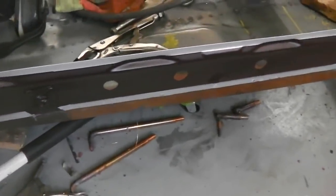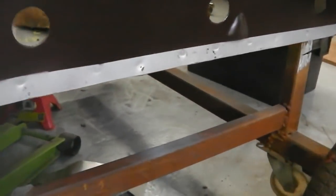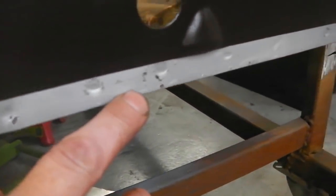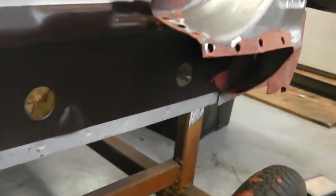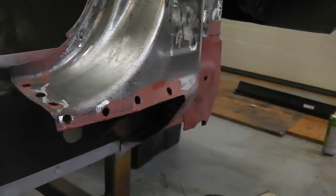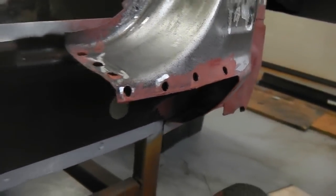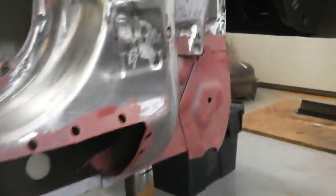This inner sill spot welded on nicely at the bottom. Got some good welding on that, but don't forget we're going through again with the outer sill, but you can see we have some nice runs of spots. Drilled out for plug welding because you can't get the spot welder into the A pillar or the B pillar, so drill out and then reprime at the back where the drill burr damages the prime. So we're ready to slot the sill into place and then tidy up that area around there.